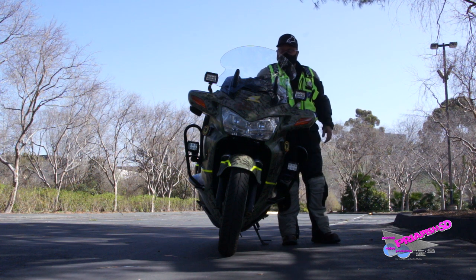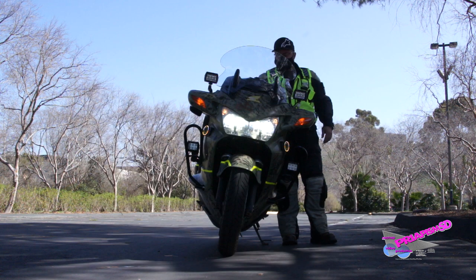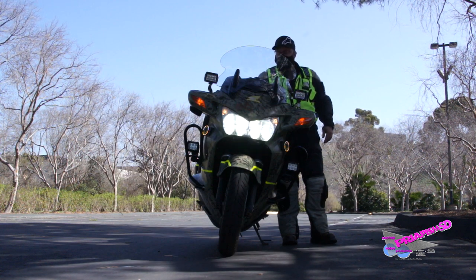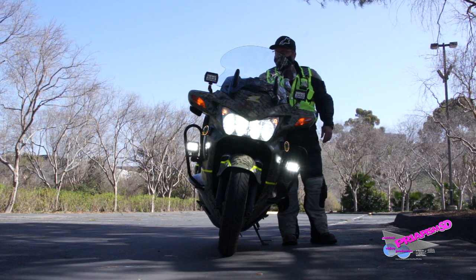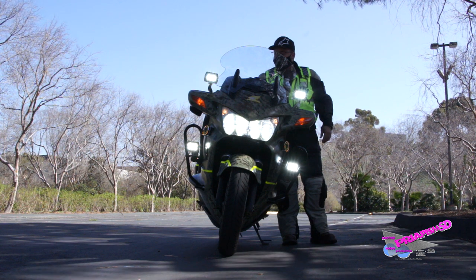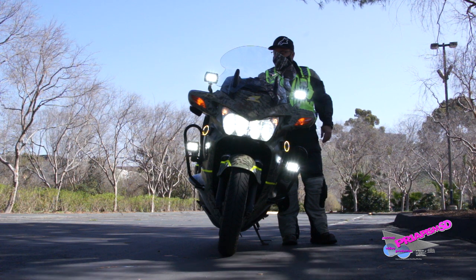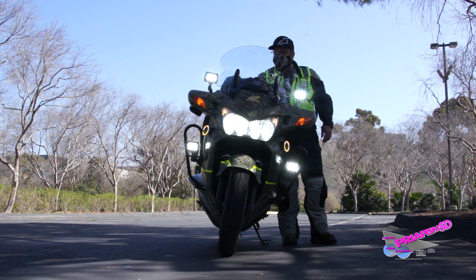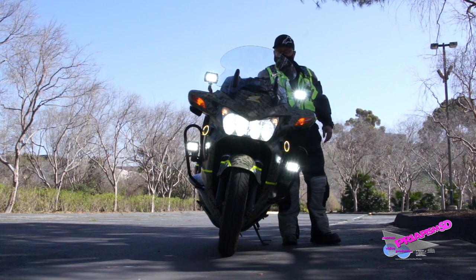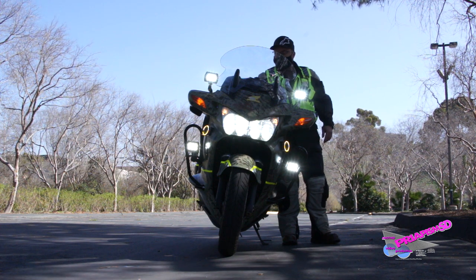The ability to run bright lights on this bike, both from alternator output and the mounts, were the main reason I chose this. I converted the headlights to LEDs — both high and low beams — much better fill, much better distance. There are also a couple of running lights on the side wired into the turn signals. Basically everything but the turn signals themselves has been converted to LED. For the lower mounts, I put a couple of flood beams — typical Amazon stuff — wider beam, better coverage in the corners. For the mounts above the handlebars, those are more of a pencil beam: a little more distance for higher speed freeway riding.